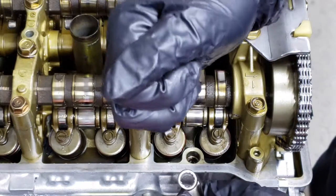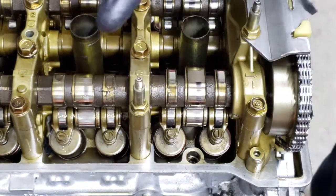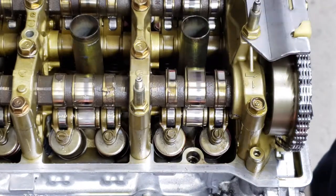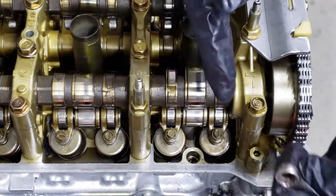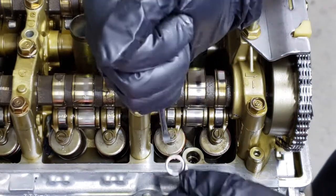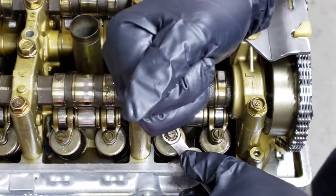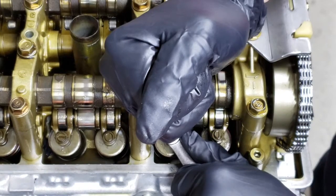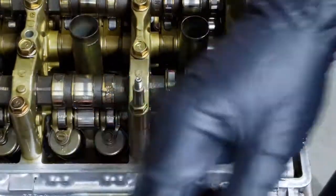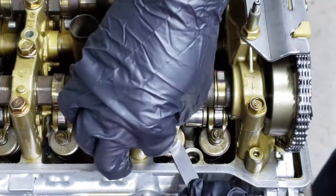Obviously, while I go, I can get the 0.011 in — I would check to see if I can get a 0.012 in. If I couldn't, then I'd still be in spec. But as long as you're in the range, you're really good. But since this is a performance application, I just really wanted to get everything just on the tightest spec possible.